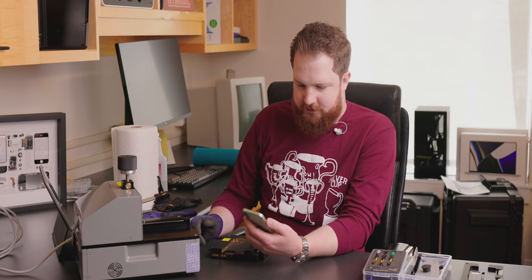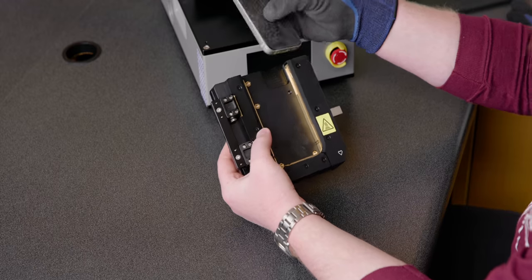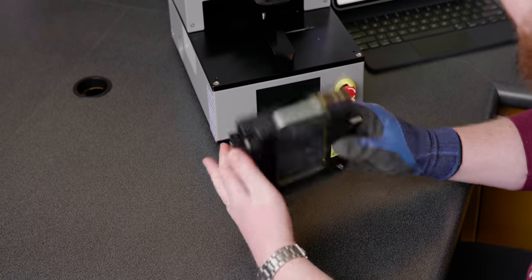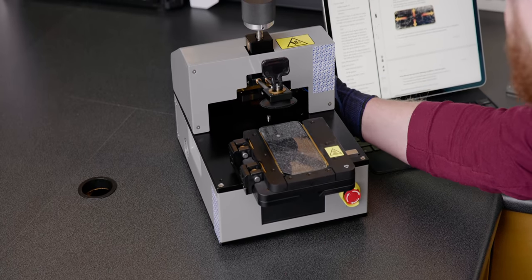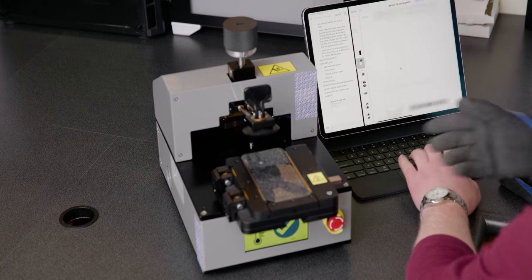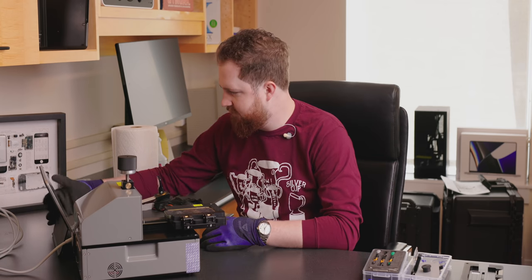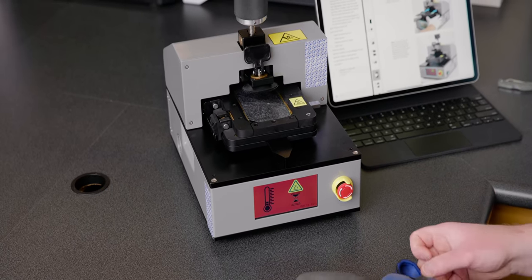Using the world's worst screen shield, we need to turn the phone off and place it into this tray. The phone slides right in and it clamps on — that is a strong clamp. We turn the machine on and wait for a check mark. The fan is very annoying. Now we gently insert the iPhone into the heated pocket. It does appear to be heating — there's a little temperature readout, and it says it takes two minutes.